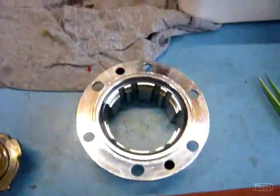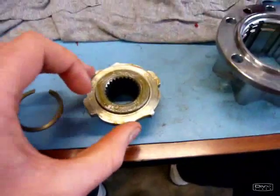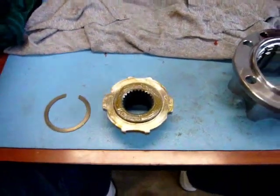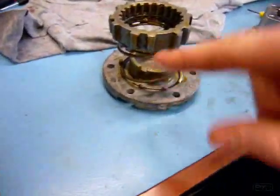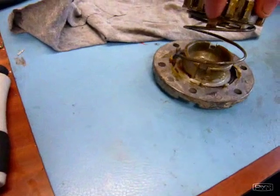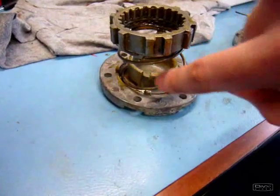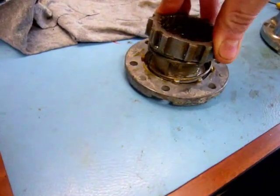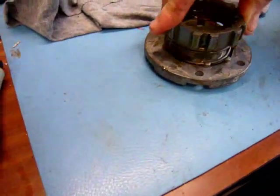Okay, so once you've cleaned everything properly and it's beautiful and nice and clean, just grease everything up reasonably well. Don't pack the grease in, but just give it a decent smear of grease. And the reassembly is basically the opposite of disassembly. To reassemble the clutch and turning mechanism, look for the little locking tabs at the bottom of the clutch. They obviously have to slide into the space in the turning mechanism, so it's a matter of pushing down like that and then turning the clutch mechanism.